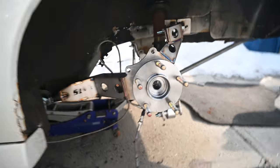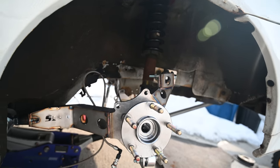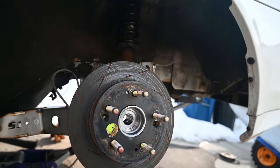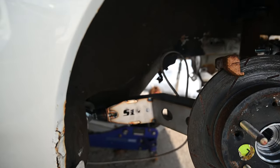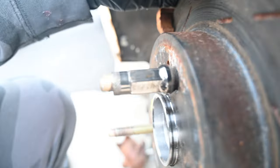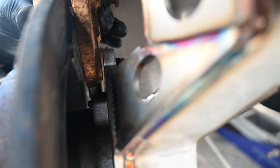I've been moving pretty fast on this side, but I still have the whole passenger side to do so I can stop and show you every little detail. When I started to get the brake rotor and caliper back on, I noticed my next gripe with the kit: the caliper bracket won't bolt up. The rotor is snugged all the way in — you can see with the lug nut holding it — and there is a substantial gap between the mounting point and the actual caliper bracket.